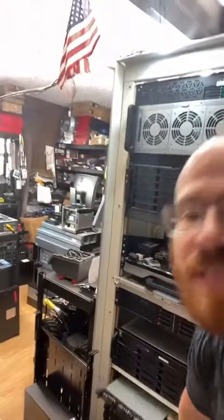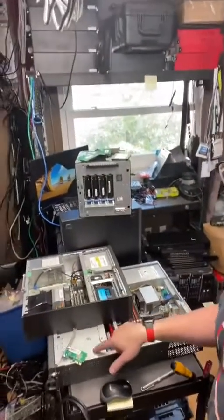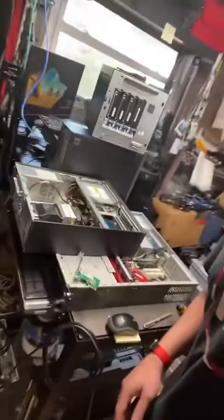Let's go back over there for a moment. This box is dying. I want to use this less shitty box and put these guts into it and make it work. But we quickly discovered we can't because the motherboard does not take a standard power connector. This one only has four drives and is starting to die, requiring more reboots. This other one has six drive slots, and I'd like to use that because it's just SATA — no SFF-8087s on it. So really, I could slam any motherboard into here, but the desktop I had isn't going to work.